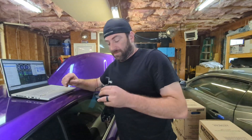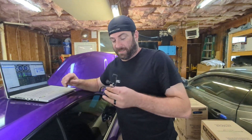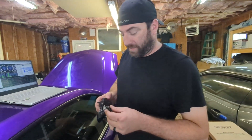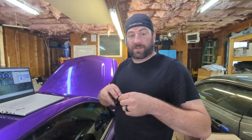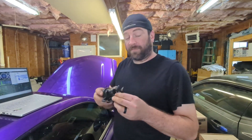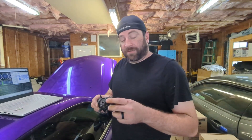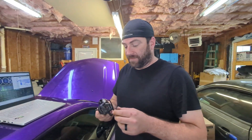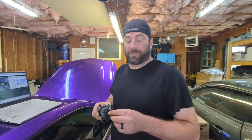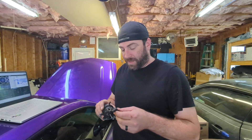Hey guys, quick YouTube short here — a little PSA with some information we just found out last week at Digger Die. This is the stock bypass valve for the supercharger on Sharon's car. We took it off and were talking with some guys down at Digger Die — the Mid-America Customs guys — and they had a couple of blowers that started having heat issues and blowing apart because the bypass valve wouldn't work anymore.